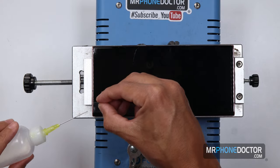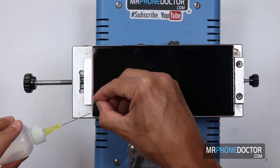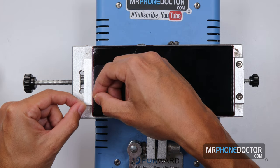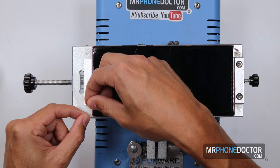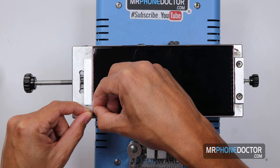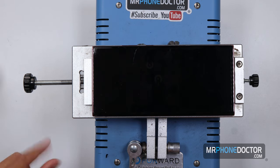So we're good. I'm gonna go ahead and just begin here, removing this first little section. And you wanna be very, very critical and sensitive here, and very, very gentle, not to damage this OLED getting in here. Just want to gently insert the OCA card on here, and this will cut all these little shards off, and any little hairline splinters and stuff like that, you want to get out of the way.